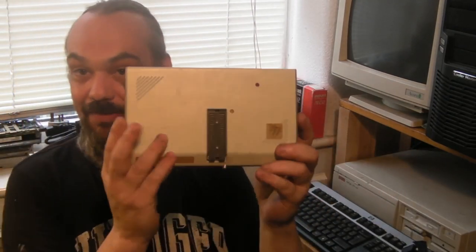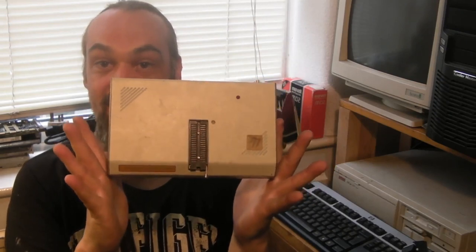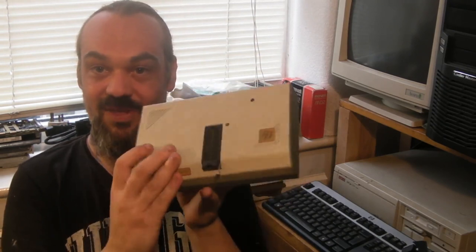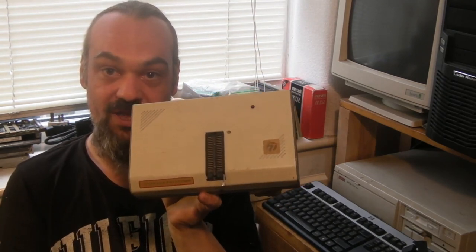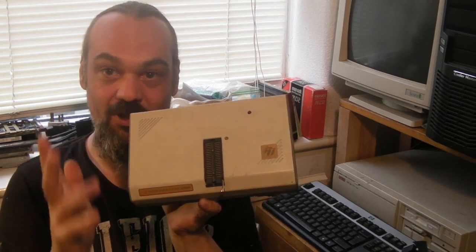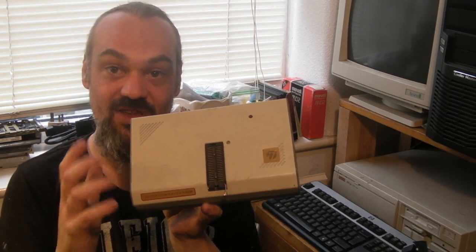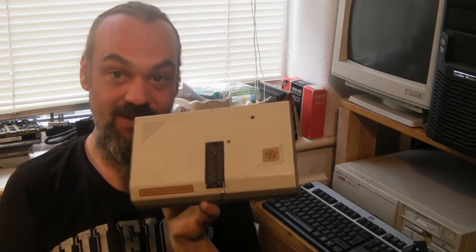I actually use this computer quite a bit, and this is the reason why I'm considering putting this in there. It has two main functions. The primary function is to control that. That's my ICE Speedmaster, EEPROM programmer, and IC analyzer. Basically I program EEPROMs on here, GALs, PALs, things like that. You can also test various RAM chips on it, and test 74 series logic. It's a very, very useful piece of kit.